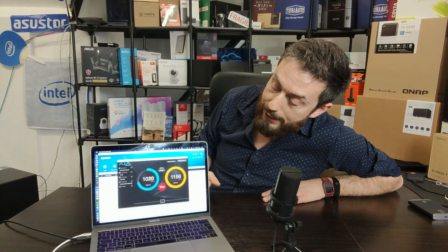We've hit 1000 MB/s immediately and we're living in that 1000 MB/s pretty exclusively throughout this. We're going to let that write go through — bear in mind this is a 4K 16 GB test file. Originally I was going to do some performance testing with BlackMagic, but it became very clear that you can't see those numbers clearly on screen. At least with AJA you have better visibility of what we're recording. Going into another rotation, we're seeing in excess of 1000, close to 1200 on read, with write still in excess of 1000.